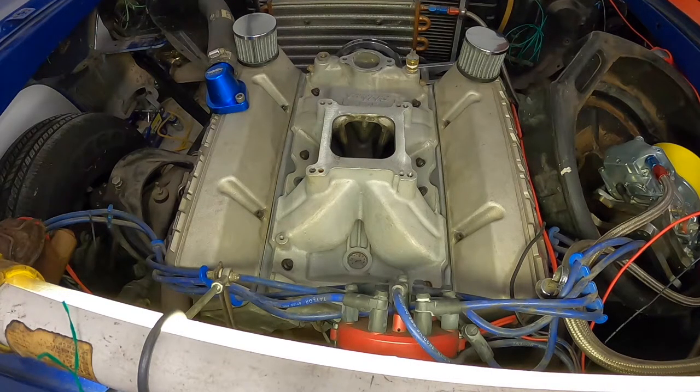This way, over time, aluminum tends to pit. And if you get any pitting, this will seal it. And just like when you push the silicone down in the little pin holes that were made to hold the gasket on there, it'll just push up in and form. You let it set up a little bit, and it kind of does the same thing as the rubber gasket or the cork, and that is, it's oversized, and when it sets up, then you can compress it, and it'll just fill in everything. Sure. So there's less squeeze out and more fill in.